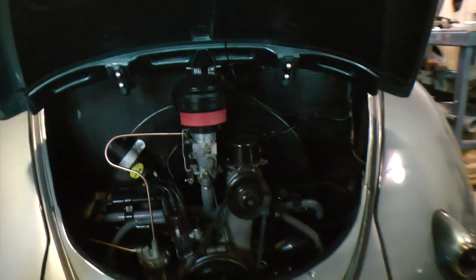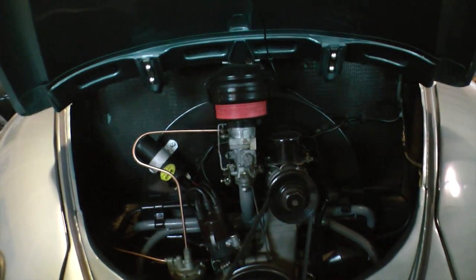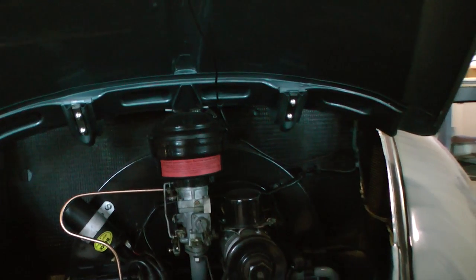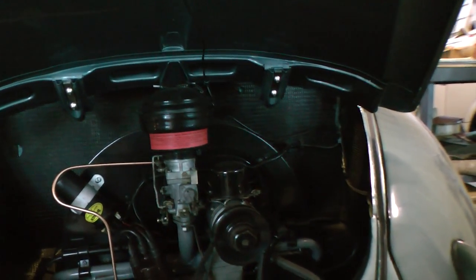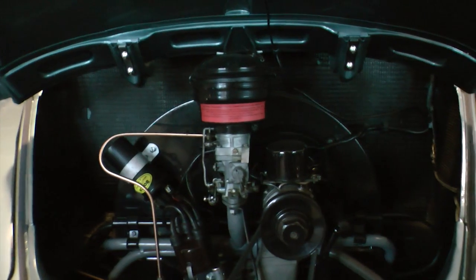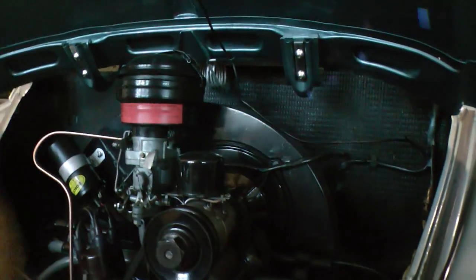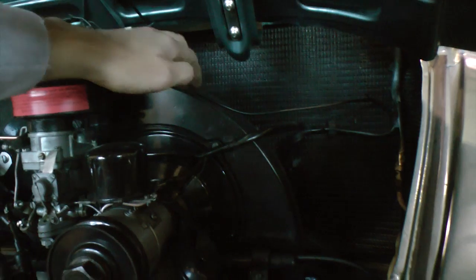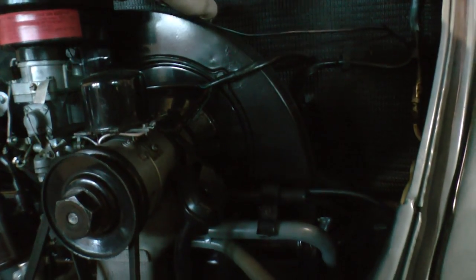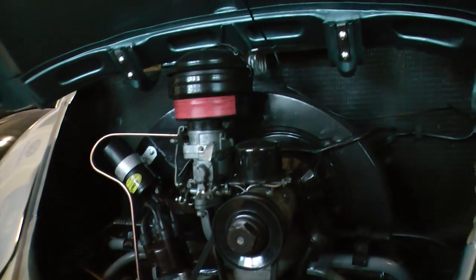One other thing that's great when your motor's out of your car while you're detailing it is to not only detail the motor, but also detail the engine bay itself. If you have a ratty tar board and it's all torn up, go buy a new one. Definitely get a German tar board. Some of the very thin tar boards on the market today, the real cheapo Brazilian, I do not recommend. They get very soft and loose while the engine's running in the car, and we've had experiences where the tar board gets so loose that it starts to get sucked into the fan. And when you do that, you start to overheat your motor. So I do not recommend that. If you want a good tar board, definitely go with a German tar board. Wolfsburg West makes a good one. So I would definitely recommend doing that.